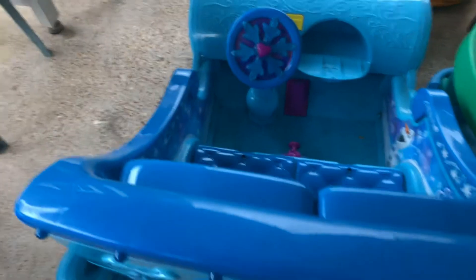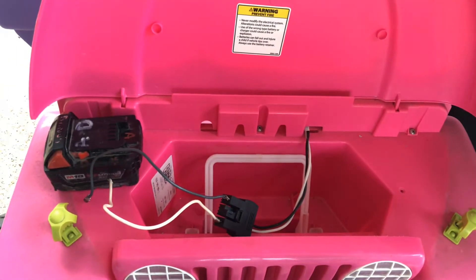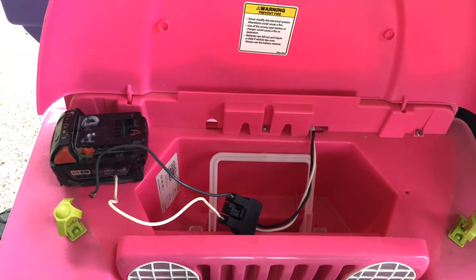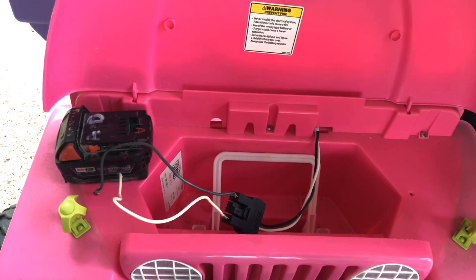I have this other one here where I've cut the plug off and left a little piece in case I ever want to use it again with the battery, and I've crimped on some fork connectors. I've seen a guy put in a voltage control switch — you can turn that switch down and you'll only be seeing about 12 volts. If you have a smaller kid, you can let them use it with the voltage turned down, and once they get bigger and can control it without running into everything, you can turn it up and get the full 18 volts.